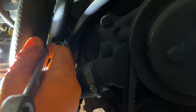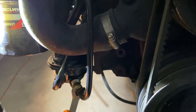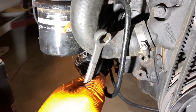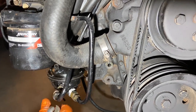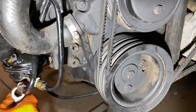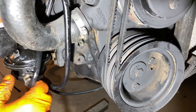A good tight fit on that. Now our fuel line that runs up to our carburetor — we're going to get that back into position and tighten it down. It's loose because I've got the carburetor removed since I had to pull the engine. All of this is a lot easier to get to with the engine out of the boat, which is why I'm doing it now instead of dealing with that failure while the engine's in there. A little preventative replacement.